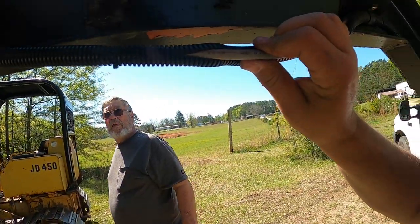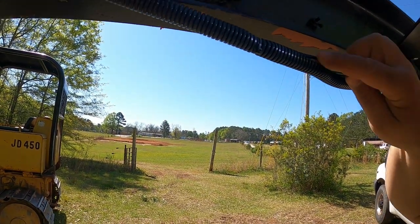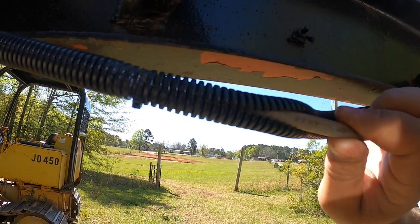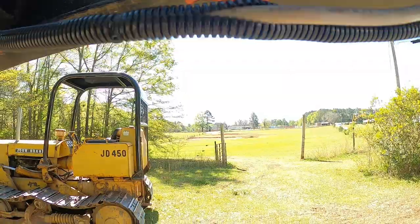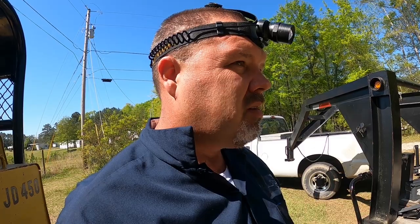If you know how to read wires — you see that? Four by 2.5: that means there's four wires, 2.5 millimeters each. That means there's no spare wires. That means we've gotta pull a new wire — there's a break in it somewhere. So this project may not be done today. At least we got taillights and right turn signal back working, and we can go from there.